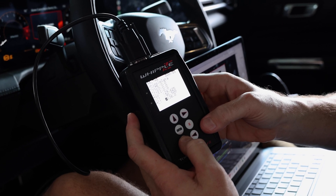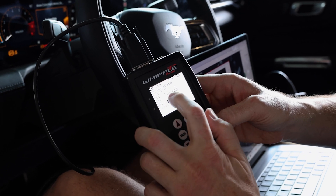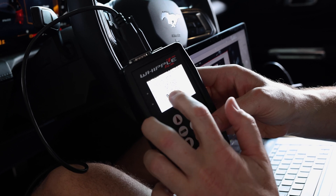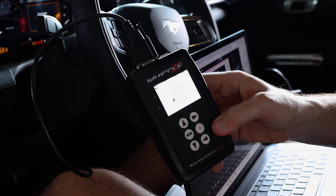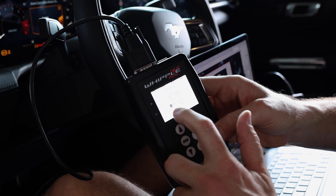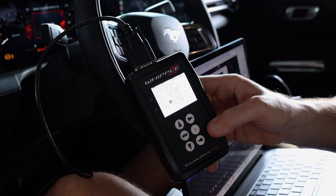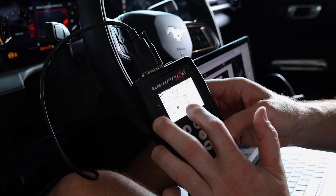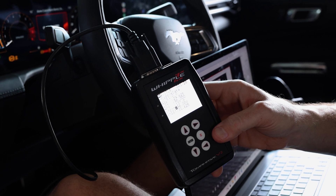I do want to show you some quick ones. You've got MAP, which right now is just atmospheric because the car's off. ACT is at the air filters. MCT is in the intake — and of course the car's off so it's soaking in its own heat. Then you've got PT ECT, that's coolant temperature in Celsius, so you've got to do the conversion to get to Fahrenheit. MCT is in Fahrenheit and coolant temps are in Celsius — it's just the way it is.